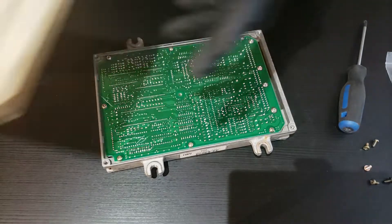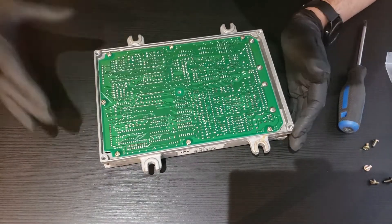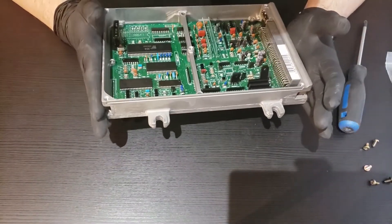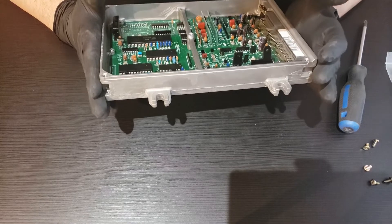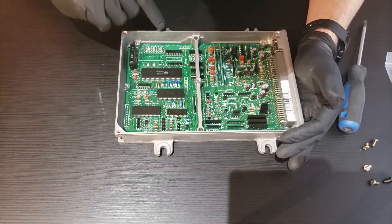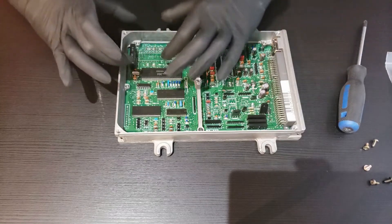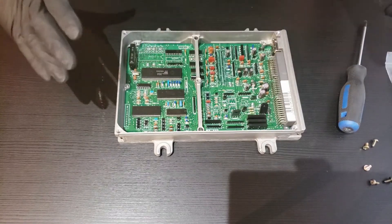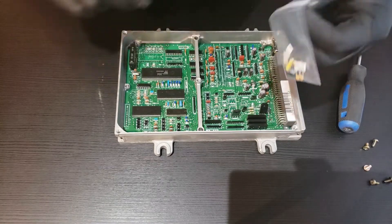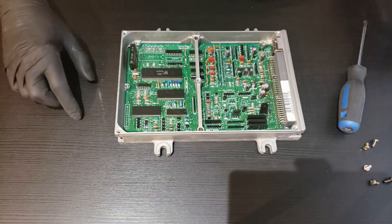That's open as well. Some people like to pull the whole ECU out of the housing, but I don't think we need to — most of the stuff is already accessible. We could do it without that, but we do have to desolder a whole bunch of stuff. We're going to work on this area first, then work our way through and finish it all off. Everything is already labeled so we just have to look and locate every single piece.